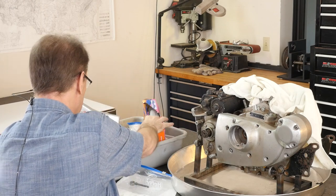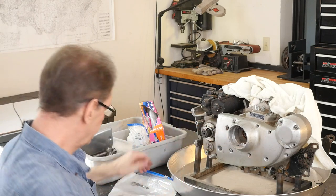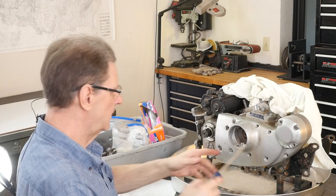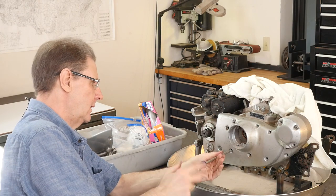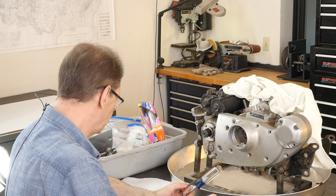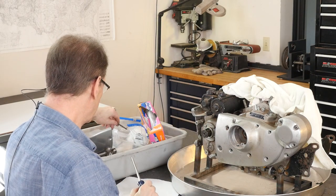So we'll put this in here with our clean stuff. There is a nut here, but no sprocket. I still don't think I got it neutral from that other show. And there's all kinds of slop there that, you know, our dog's really that loose. I guess we can put this here. Now the sprocket cover, or the gear case cover. Oh God. This is later model, you can tell. 77s had a vent and a big one-way check valve here. What's it called, the woohoo valve or something, because it can make a funny sound when it gets oil in it. Or maybe that's the one that's inside. This one will have one, I think, built inside, and then they vent here up into the carburetor air filter area.